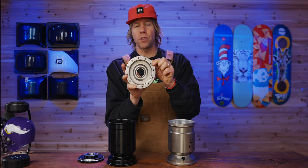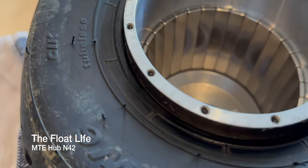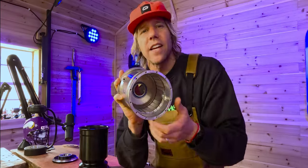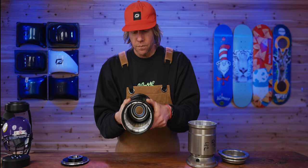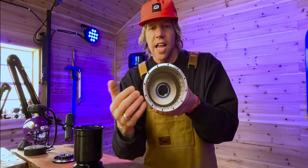You can already see that the MTE comes off as a complete oval — you have your screw holes and everything, comes right off with the bearing in there. Very different than the inner hub of the One Wheel Parts. One of the cool things about the MTEs is you know exactly what magnets you have — it is etched inside, it says N42, so you know without a shadow of a doubt. It's even labeled on the outside. When we look inside the One Wheel Parts hub, there is nothing to tell me that I have purchased the N48 magnet strength.